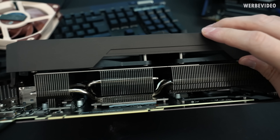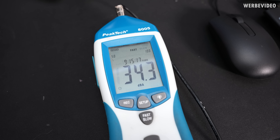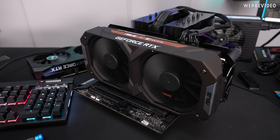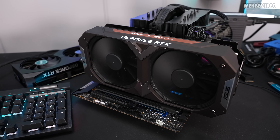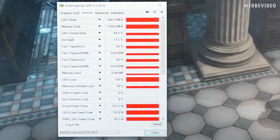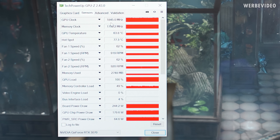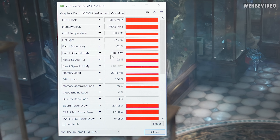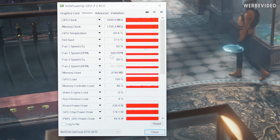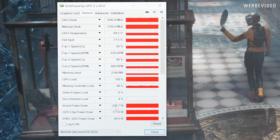We can also see there is a small gap between the fan and the heatsink itself. Comparing to the A12 fans, the F12 was just 1 dB louder, which for my setup is definitely within measurement tolerance. Just to double-check, the temperature is about the same as with the Noctua card. The clock is slightly lower than on the DUAL card. Comparing the F12 fans to the A12 fans, there is an increased fan speed of about 30 to 40 RPM on the F12 fans, but that's still absolutely okay, and the power draw is still the same.